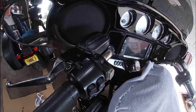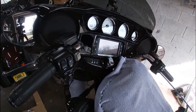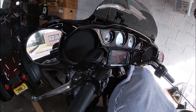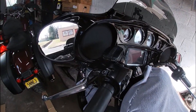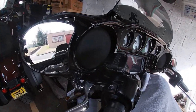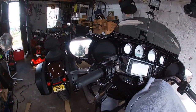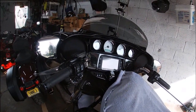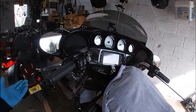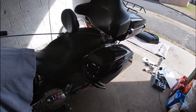So again, that's the extent of it — it's not that hard of a job. I'm at maybe 27 minutes to do this job. I had to clean off the lid, spent five or six minutes doing that, going inside, grabbing the other diaphragm. You could probably do this in 20 minutes with a fresh Mighty Vac ready to go. If you have somebody to help you keep your master cylinder topped off, you can do it even faster. I usually work alone. So again, this is maintenance that needs to be done — every two years you flush your brake system and flush your hydraulic clutch if you have one. I'm sitting at probably not even two hours to do everything myself. Don't forget to hit like and subscribe, and I'll see you guys in whatever we're working on next — maybe the new air ride shocks I have to put on.